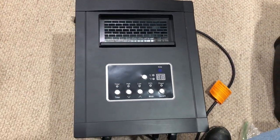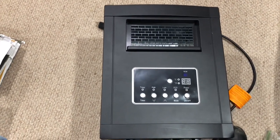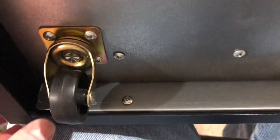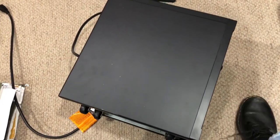So if you're handy with a screwdriver, there's a good chance you could probably fix your unit. To start off, you're going to want to remove — at least on my unit — the left side panel here. It's a plastic panel, so that's the side we want to access and remove. To remove the left side panel there are five screws. Just lay the unit on its side and you'll see them. Get those five screws and the side panel will come off. You don't need to mess with the ones directly on the bottom — just the ones on the side rim. Once you've got the screws off, remove this side panel and pull it out.